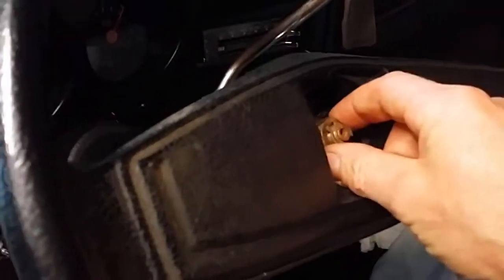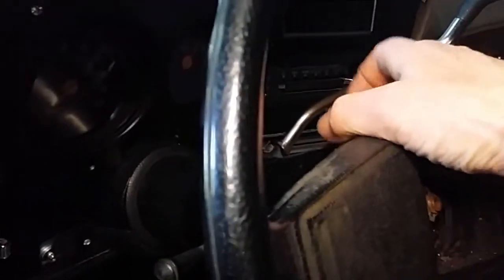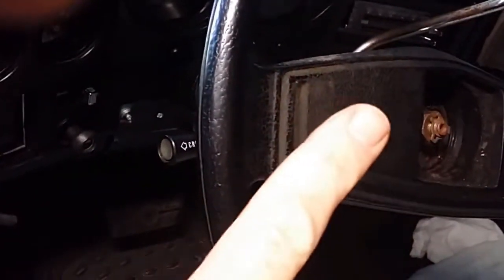It's a lot of work to replace the ignition switch. You have to undo all of this, and you need 2 special tools to get the steering wheel off. There's also a spring trap mechanism on the inside that has to be released, and a small round washer has to be prized out to expose the ignition switch. But the ignition switch doesn't actually have any terminals or wires running to it. What that activates is a type of mechanism that's turned just inside there. So I'd say the ignition switch is good.